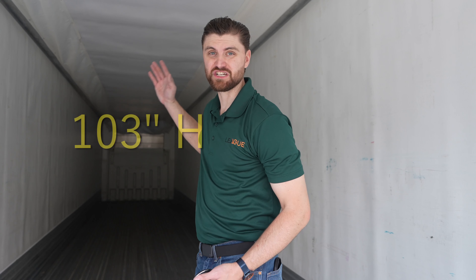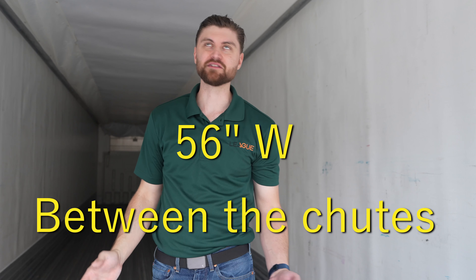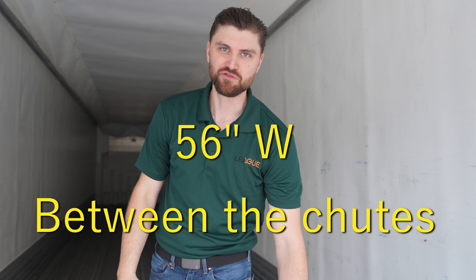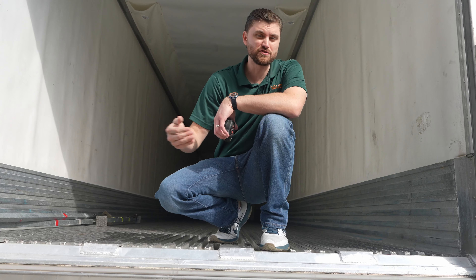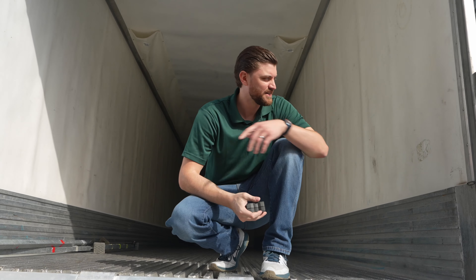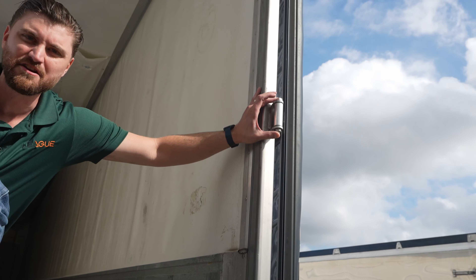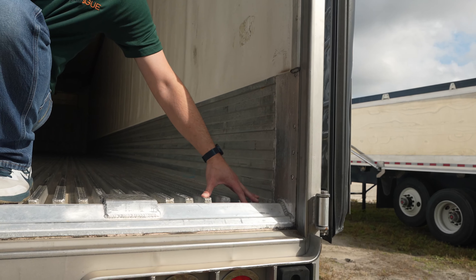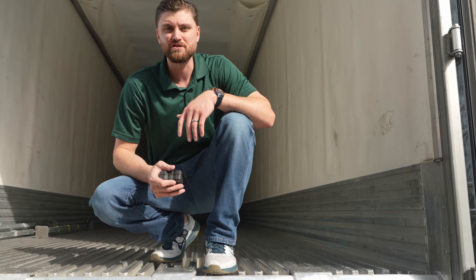On height we actually have 103 inches in the center where we can stack freight or utilize tall cargo. If you're doing 40-by-48 pallets, this is perfect because you have 56 inches between each chute. As for swing doors versus roll-up doors, how much room are you losing with the door to get a pallet through? Absolutely none — the hinges are on the outside, so you get the full width of the trailer all the way from the back to loading. There's nothing to measure; it's perfect.